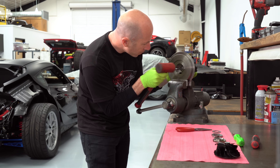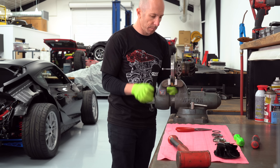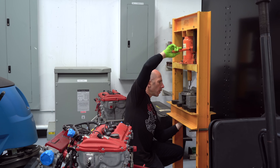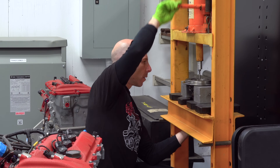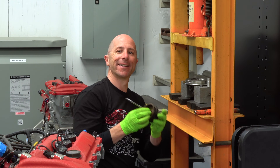I'm trying to remember back when I had some instruction from the Borg Warner guy on how to take this apart, and I'm pretty sure he didn't say hammer it. I quickly realized that was not the way to do it. It seemed like the turbo shaft was pressed in there, so I brought it over to the press to press out the turbine shaft — always scary, but after a couple of pumps it broke free and started sliding out. That was definitely a sigh of relief.